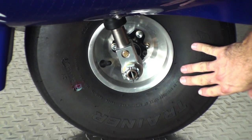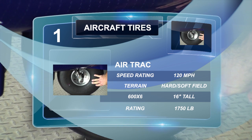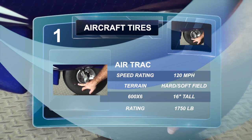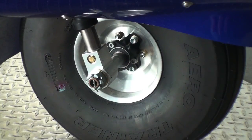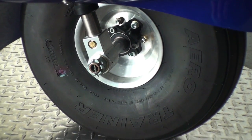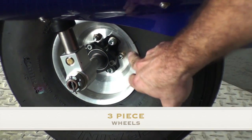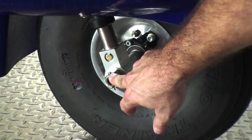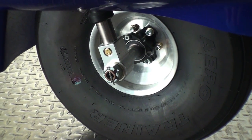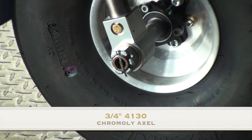This is actually a GA certified aircraft tire, 6-ply, rated to 120 miles per hour. This is a three-piece wheel rated for 1,800 pounds. It also allows us to run the tires tubeless because it uses a bead seal in between. Notice the size of this axle — this is a 3/4 inch axle, as opposed to the usual 5/8 inch axle you'd find on most other trikes.